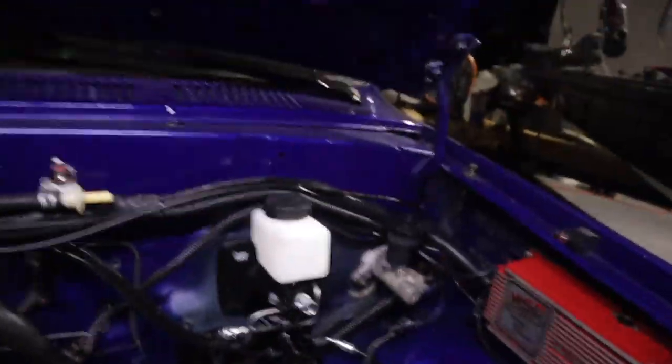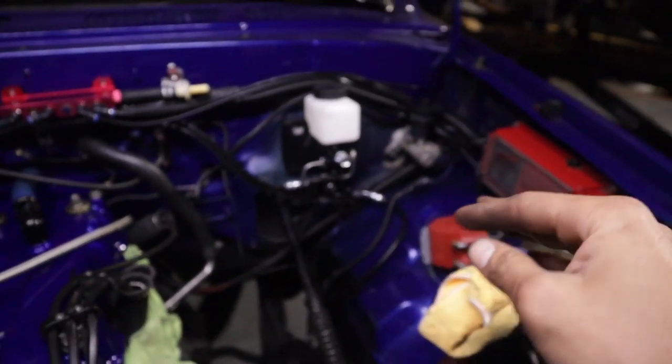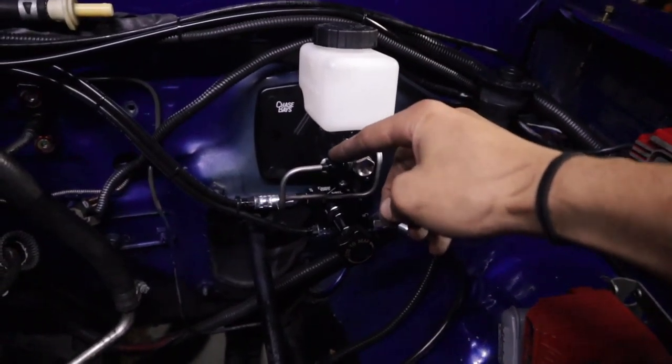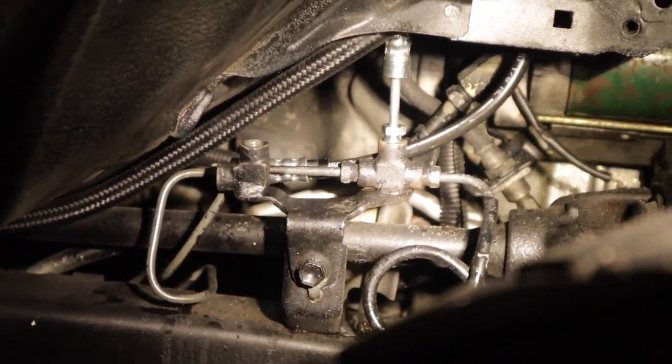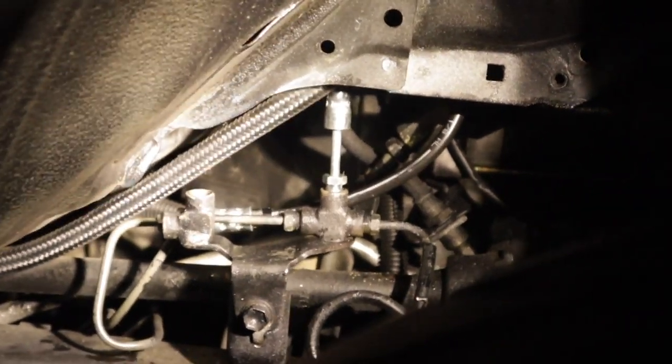I've been tackling the truck for quite a while now and this is where I'm going to end this video. I wire-tucked all these wires going over top of the reservoir. My vacuum lines and everything are looking nice and clean. I tightened up all the brake lines and ran them all the way through. Down here you can see the brake lines are nice and connected — this one goes to the front brakes and this one goes to the rear. I put it behind the bar so it'll hide and no one can come up and cut my brake lines. The next video I'm going to bleed all the brake lines and show you guys the ending results and how the pedal feels. Stay tuned for part two — super excited. Peace!